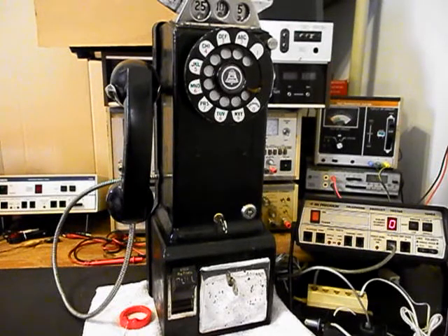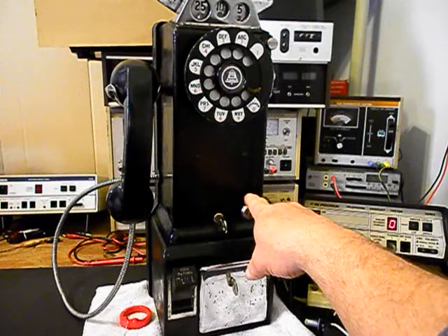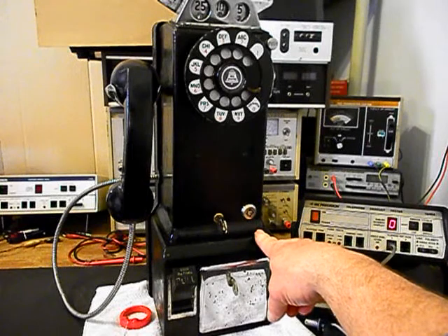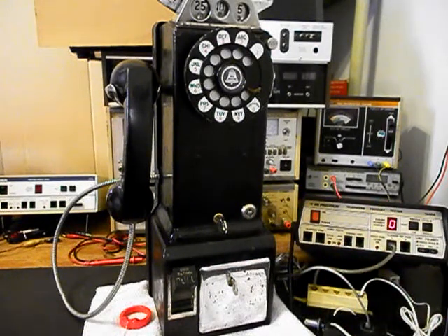You also have to plug the front cover into the backboard. There is a wiring harness that has a plug on it, and there's a plug on the backboard — you've got to plug them in for the telephone to work. It makes a connection to your rotary, and they only give you a short pigtail for that plug. You've got to basically take the cover and put it on and then make your connection, because they only give you a couple of inches. We'll show that in a picture, along with the dial center card. Also, the modular port was installed in the back of this unit — you can simply plug any color line cord, any length, right into the modular port for a simple, easy plug-and-play connection.